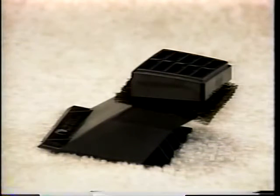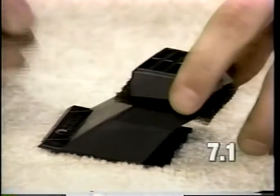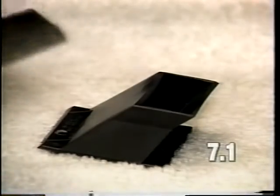If the problem is the motor runs hot on an earlier model, Generation 3, it could be due to a blocked exhaust vent screen. Remove and discard the filter if it is in place.